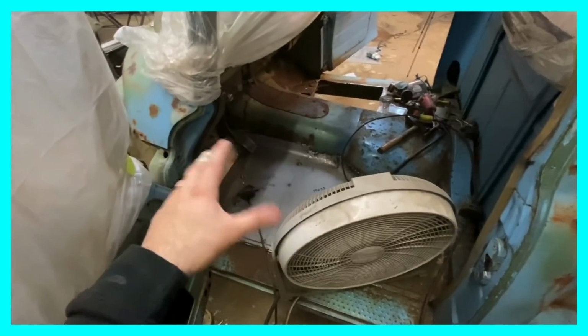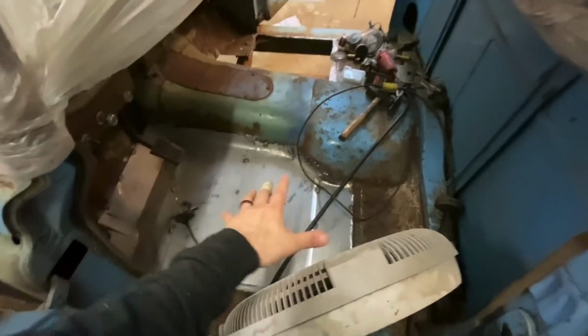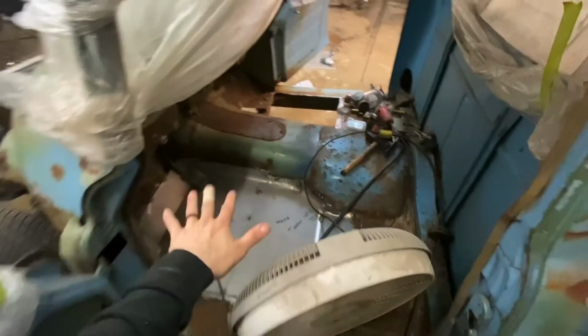You don't really have to fully weld your floors anyway, you just need to kind of stitch weld them, but I definitely want to have a filter on. And the filter I have right now does not go underneath my welding mask. So we're just going for tacks. Fabrication's all done, absolutely looks great.